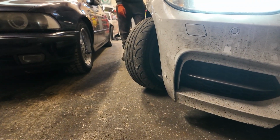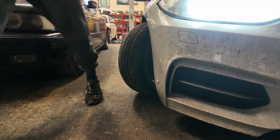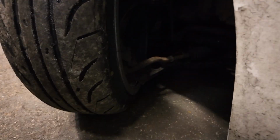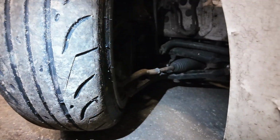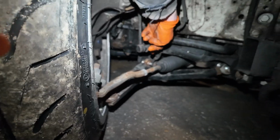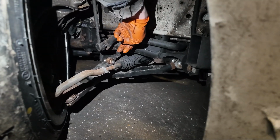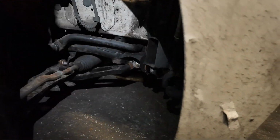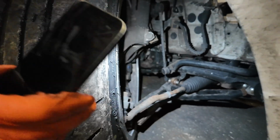So it's got some pretty impressive lock. It's not too bad. It's basically just an E92 CNC kit, reasonably heavily modified. It's got the lower arm, the middle rose joint has been cut to fit. On the front, it has been spaced out to give, if you look at the angle of the wheels, you can't really see from there, but it's got a really decent amount of caster. The self-steer's really good.